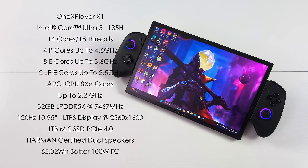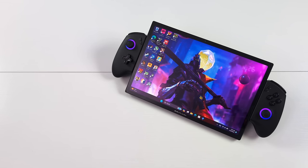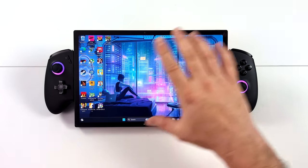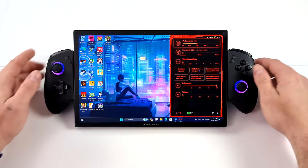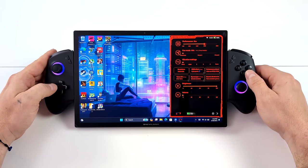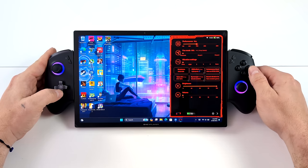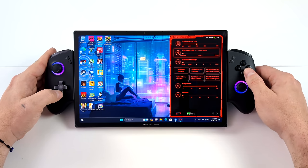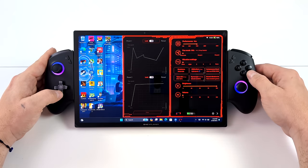I want to give you a look at their One X console they have built in here — it allows a lot of tweaking and tuning for the new X1. There are several different ways to access it, but I usually just tap the turbo button up top; it'll bring it on screen even while you're playing a game. The top section is our TDP — we can go from 5 watts up to 28, and when plugged into the wall, it actually boosts up to 35, which does allow for better performance.